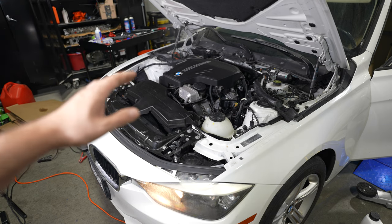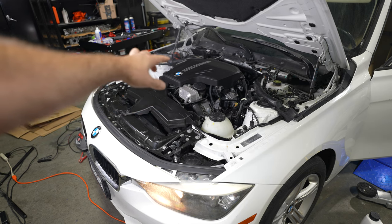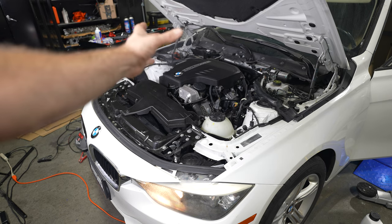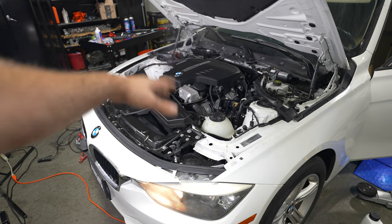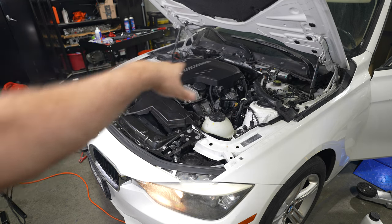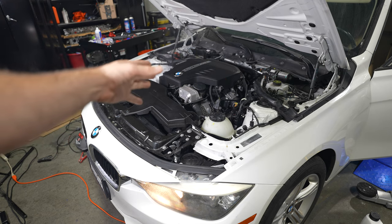By the way, we're running break-in oil in here right now. Because of the clearances on the cylinder block, we opted to not use the honing tool because we didn't want to make the clearances more than they need to be. We already checked by rotating the motor over a couple times that they were shiny and the mating had already started, but we're using break-in oil to really get the rings to bed properly like a new engine.